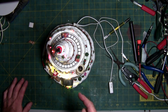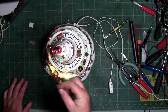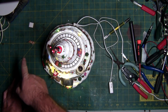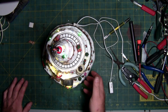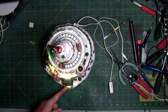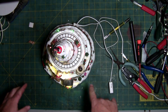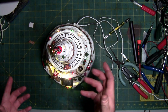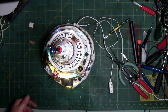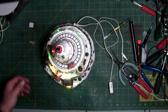Then reverse the process. Now, I would recommend removing the shaft like I did when I finally got to that point. Sticking it into the bottom, so the four fingers, in my case three, line up with the drive mechanism here. Then, looking through the hole for where the deer goes, eyeball it and get that shaft to line up into the square hole in the bottom. And then work it in, make sure it's flush, set it down flush, and then fire it up. Make sure it doesn't bind, crack, or make a funny sound, because then you know something's out of alignment.